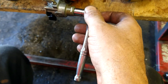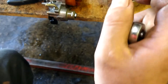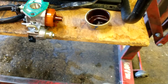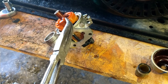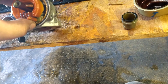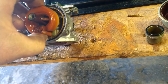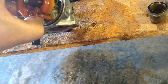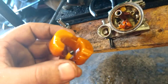Take this 10 millimeter off. If it strips, you can use pliers, but don't even bother — we'll rinse through this side and through where the needle goes and clean it out. Pull this pin out and pull the float out. It's kind of sticking so just use even pressure — don't force it; it'll eventually give. It's all tarred up and stuck; we're going to be cleaning the crap out of this stuff.